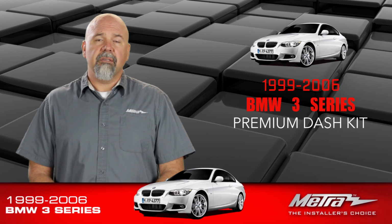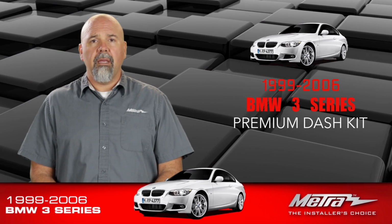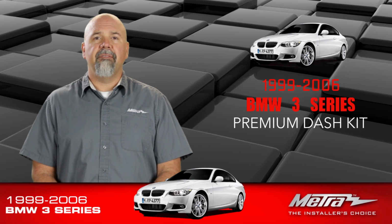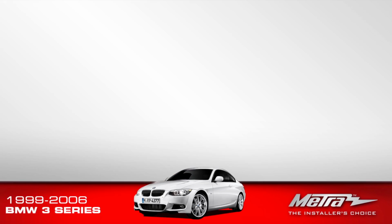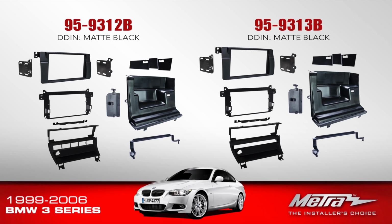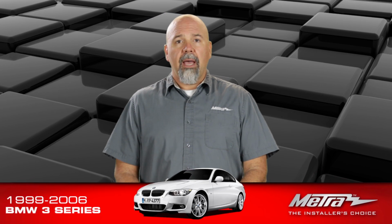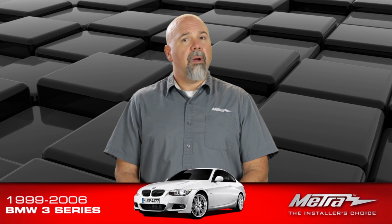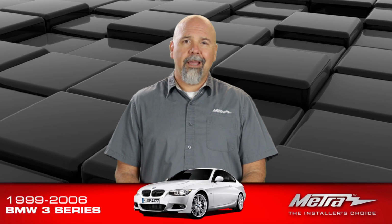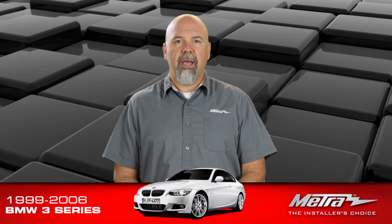In this video, we're going to discuss the details of the installation kit for double-DIN radios in the E46 BMW from 1999 to 2006. There have been other solutions for installation of a double-DIN radio, but with the 95-9312 and 95-9313B, this solution provides a flush mount installation kit. To do that, we've included parts for cutting the airbox and the sub-dash. It's a little detailed, but with all the parts and instructions that we put together, it's not so bad.